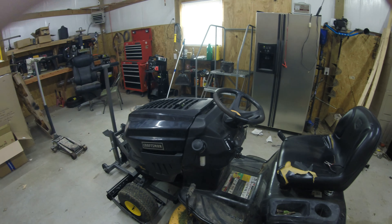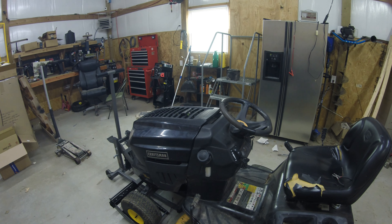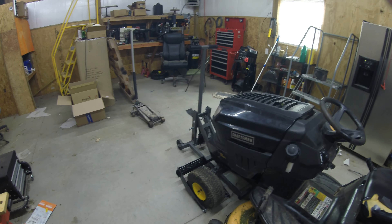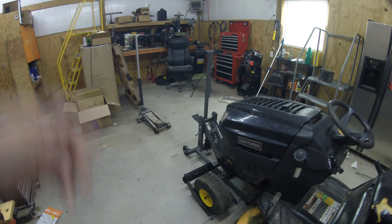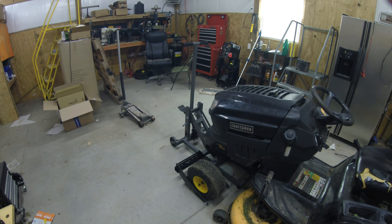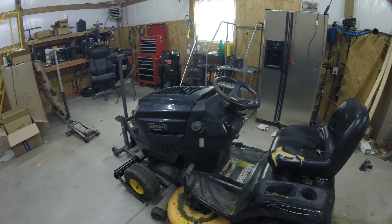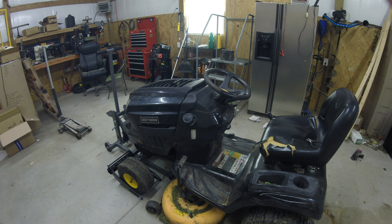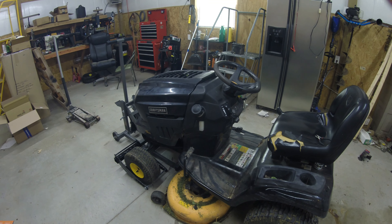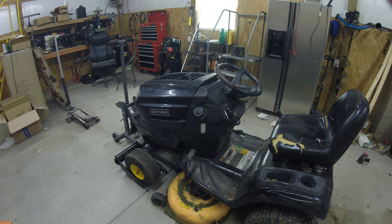Then I look behind me and I've got a scalp spot — you know, like cutting dirt. So I'm like shoot, must have been a blade. Long story short, I pull in here, use my fancy little lift that I got — by the way go check out the review I did on that, it's going to be handy. I lift up the deck, put my hand underneath there, and I could move the blade. I broke the spindle. Six years and I've hit many things but never broke a spindle, but go figure.